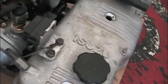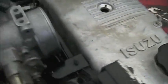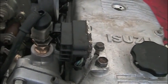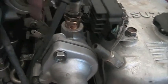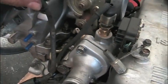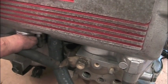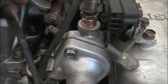When this thing is complete it looks sort of like this. What I've done here is I've got the igniter mounted right up here — there were just conveniently two little bosses where I could bolt that in. There's a ground strap right here — normally this mounts back here off the back of the head and runs up to the valve cover. I've just relocated it from that stud up to the igniter, just to help ensure a ground to the top of the valve cover. The igniter and coolant temperature sensor are mounted right here — you'll have to plug in the yellow wire for your gauge right there. I've relocated the idle air control valve right here to the front, with the plug coming off the top of the throttle with the bypass hose, and it routes right around to its original location. This is an intake port for your charcoal canister — I've capped that off because I'm not running that.